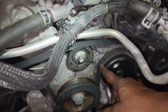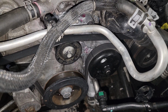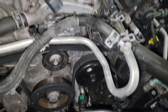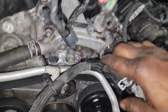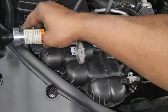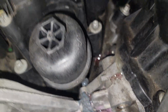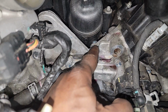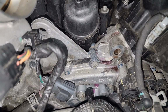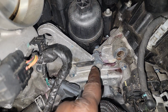However, if you look right here, see all that cooling residual? Yes, it looks just like coolant coming from the water pump. But with me having pressure on the system, I can see. Well, where's it coming from? See, it's higher up and it's working its way down. Oh no, man! Please don't tell me somebody broke this.